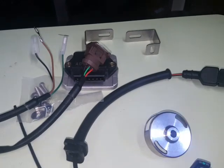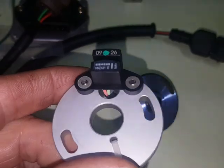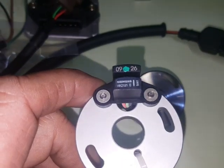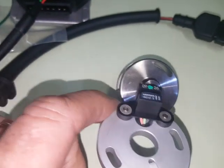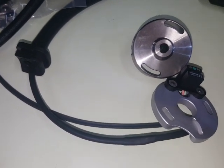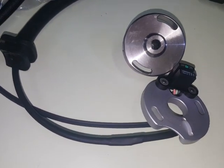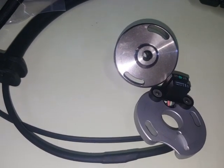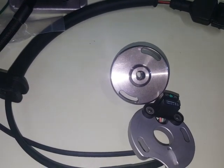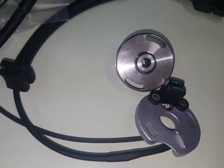And your system is good to go. It's as simple as that. This Hall Effect trigger that's on here — I've been told that they are made by Honeywell. I'm not going to argue with anyone who says otherwise. But you can buy them from Jaycar for under $20. They're a simple three-wire setup. They're the same unit and interchangeable with the unit that BMW use in their factory cans. And it is as easy to change one of those as it is to change a set of points, with the exception that you have to just join the three wires onto the harness to make it work. So that's what it all looks like in the box and that's how it works. Now I'm going to show you how it is fitted into my own bike.